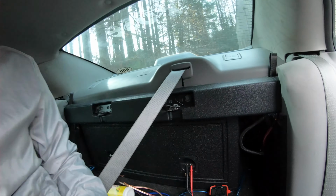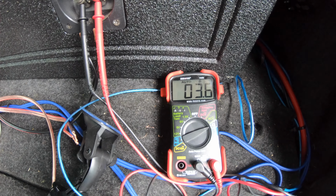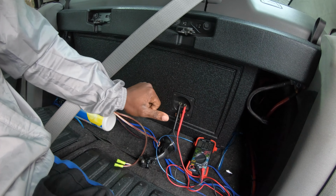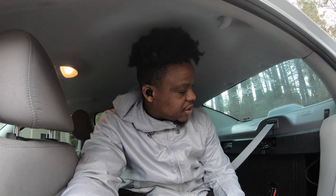And so right now, boom, as y'all can see, I have a new box in here. Speakers are wired down to 4. I should wire it down to 2 ohms and just run it at separate channels instead of bridge. It'd be better for these. Well, this is a Rhino box, and each speaker gets about 1.5 cube, and it's not too bad. I don't like that it taps out, like it reaches its peak at like 40 hertz. And I don't like that, because one of my favorite songs just don't sound right in this box. So this is why I like building my own box, and I don't want to build another box.